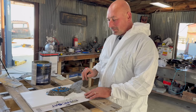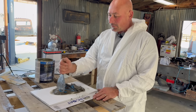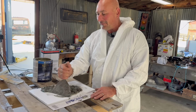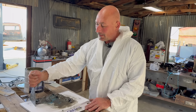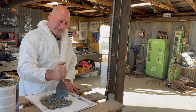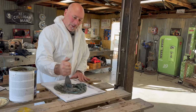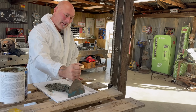So there's that. Again, with this Evercoat, they provided these cool palettes with the paper that peels off layer after layer. So I've noticed with this really thick material, and I tend to push it around pretty rough, sometimes the paper will tear, but so far, day five working on this palette, it's holding together wonderfully. So just like the liquid resin in that tub, I'm working on the edges, trying to mix everything evenly, then I'm going right through the big blob in the center, trying to get that catalyst, the blue material, evenly distributed,